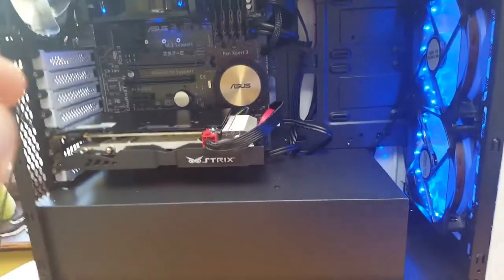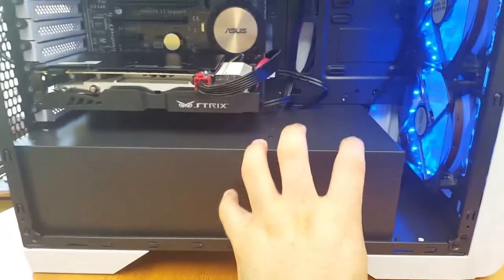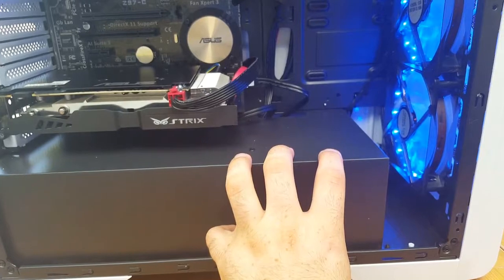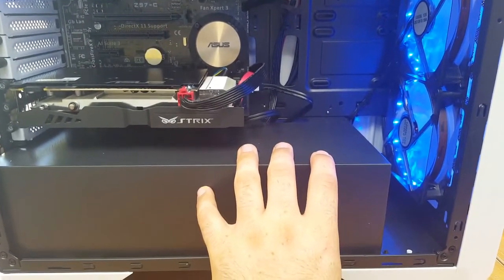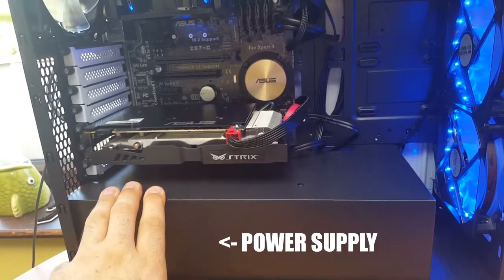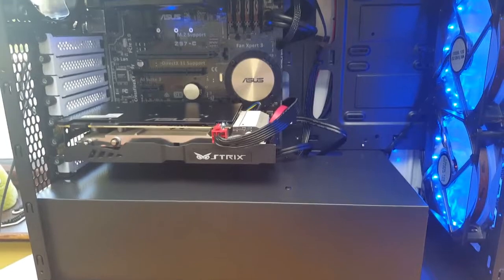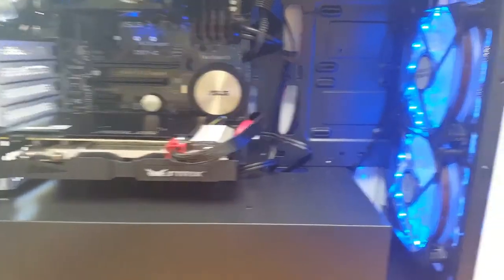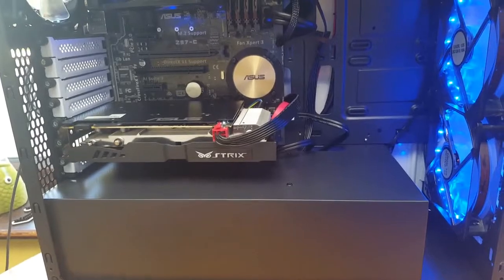The other really nice feature is this black box here. This is where you've got the hard drive bays — two bays for 3.5 or 2.5 inch drives, though you'll need an adapter for any 2.5 inch SSDs to fit a 3.5 bay. This power supply is a Hive 850. I chose this one because I don't want more than about 40% load on the PSU at any time, otherwise you're going to wear it out a lot quicker.